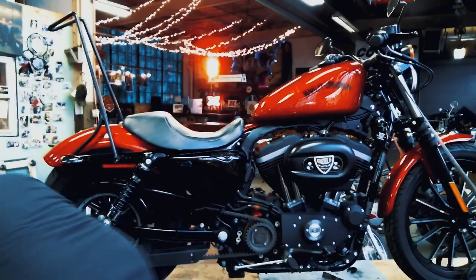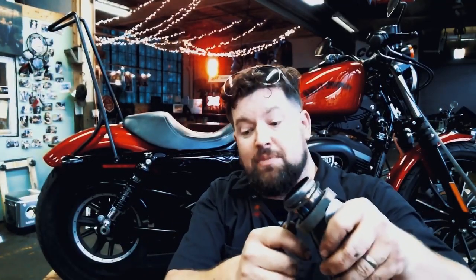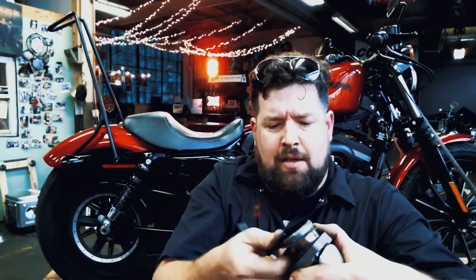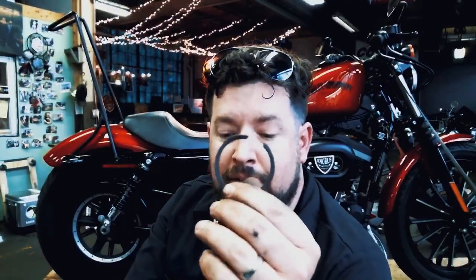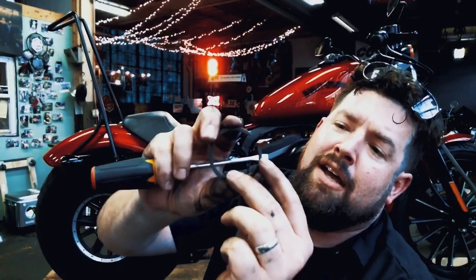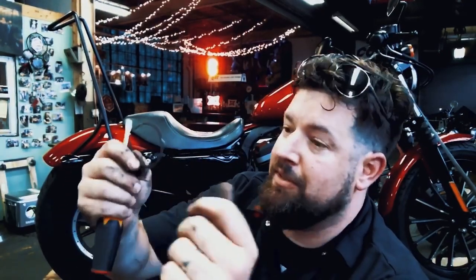Keep track of that. This snap ring was actually damaged from the factory — they did not put it on straight. So we'll pry this sucker off just to show you what a damaged one looks like. You can see this one is awfully warped — it was dished in when they put the flange back up from the factory. Must have been a Puckett Friday. The snap ring wasn't set inside the cylinder head, so when they tightened it down, it actually flared out a little bit. Might even have had an exhaust leak. This is trash.